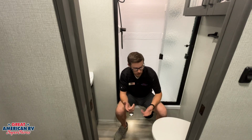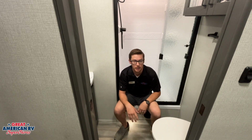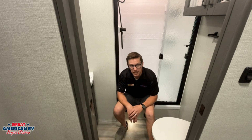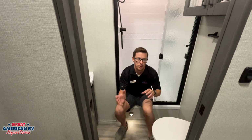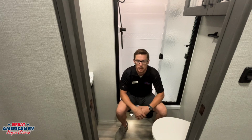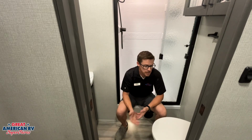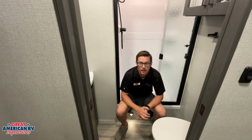So let's talk about number 1 and number 2. Number 1 is just liquids, right? We're just going to hit that pedal, flush it down the drain. Number 2, we have solids. When we use it, we need to barely depress that pedal down and fill that bowl about 1/2 to 3/4 of the way so those solids, toilet paper, all that stuff can flush down. There's enough water to push that stuff all the way down the pipe. Otherwise, you can run into some clogging issues. Besides that, RV toilet paper, chemicals, all that stuff goes through here. And then, of course, we always make sure we have water in that tank.